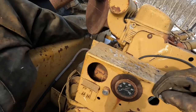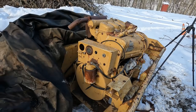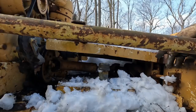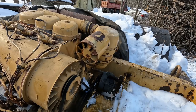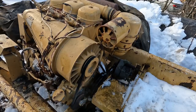Other ways you could do it would be to either pull the starter off, or sometimes you can get into the flywheel and use a bar and try to bar it over with the teeth on the flywheel — just watch you don't damage the flywheel when you're doing that. If the engine doesn't appear to be free, you've also got to look at what it's connected to. In this case there's a drive shaft running to a line shaft, which spins the counterweight in the drum to make it vibrate. If the engine doesn't want to move, make sure whatever it's connected to isn't the reason it's stuck. Other things could be water pumps, alternators, power steering pumps, gear-driven air compressors — accessory drive stuff is what you need to check.